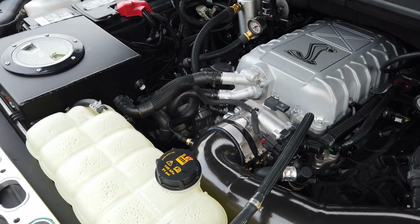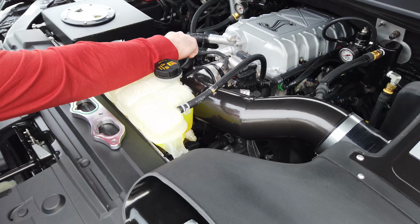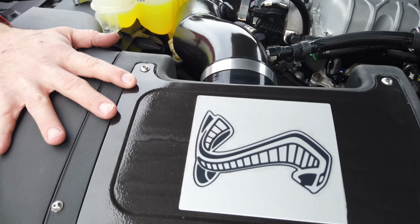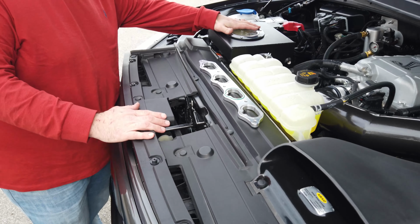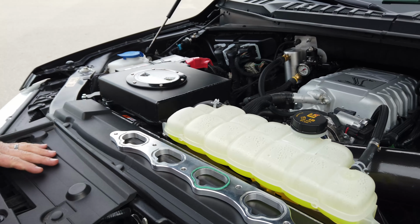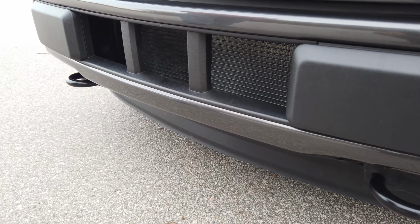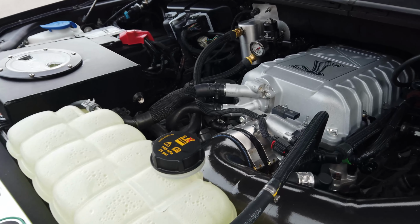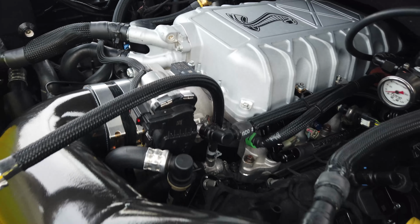All right. So it's got the 2020 Shelby blower on it. That's 100% stock. Stock 92 millimeter throttle body. The intake pipe, I made that. This is an Airaid box with just a regular Airaid filter in it. It's got a Bwoody 15 to 20 F-150 coolant tank, an icebox tank. Reached out to VMP and we installed a triple pass heat exchanger in it with a Whipple intercooler pump. And it's got all the fuel system in it except for the regulators, and FIC 1000 injectors in it.